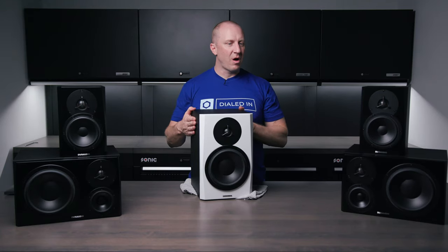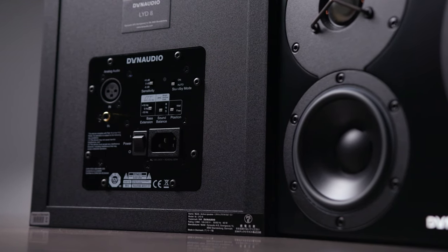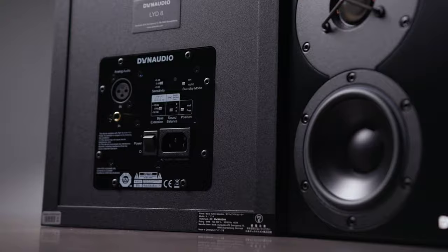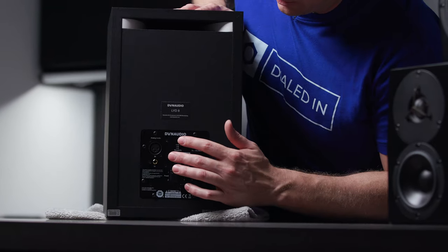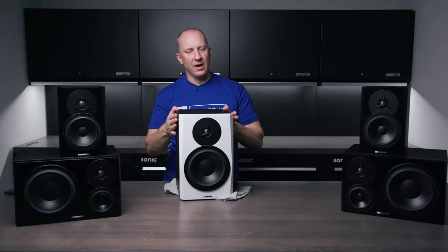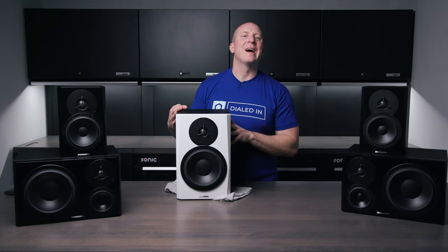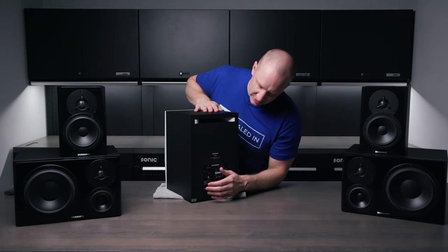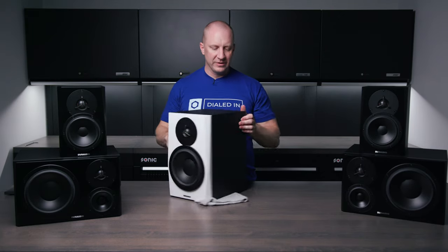But the beauty of these is if you're in the garage and you don't want to disturb everybody in the house and you're listening to low to moderate volume, these sound just as good at low volume as they do at high volume, and you do have some adjustability here. And then the final adjustment, which you're not going to mess with much, you'll just hook up whatever your device is. For me, I'm using a Blue Sound node in order to power these. I'm going to run these and do 24-bit 192 kilohertz when I can, listening to Tidal and MQA. Generally the input sensitivity, you'll adjust depending on where your volume's at. Really, really simple. So they all have the same adjustment, LYD 5 all the way up to the LYD 48s.